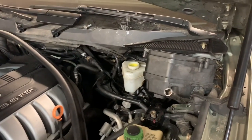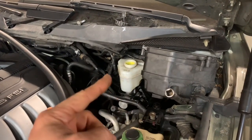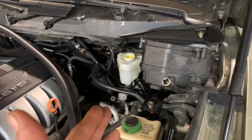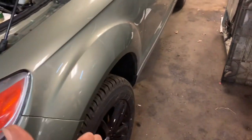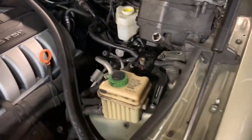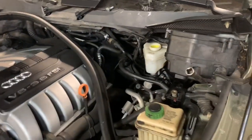Now the person helping you has to follow instructions correctly. Because if they release the brake pedal while the lines are open, you're going to suck fluid up through the lines and actually put air inside your lines where you already didn't have any. But just think about how awesome this is going to be without having to take off the wheels — and if you're in Michigan where it's rusty, having to deal with rusty bleeder screws on the brake calipers. So if this actually works, it's going to be really good for all of us.